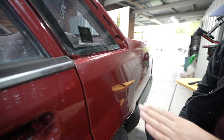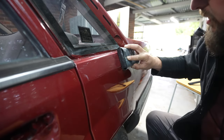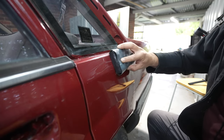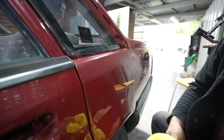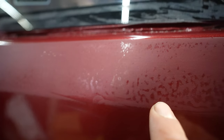You can actually see it here. As it dries — sometimes I get my car blower out to dry it — when it's dry you can really see all the little imperfections, dust, all that kind of stuff. So here it is; you can actually see how bad it is. Where it's still shiny, that's where the sandpaper hasn't hit, and that shows how ripply it actually is. We want to keep sanding until it is completely flat.